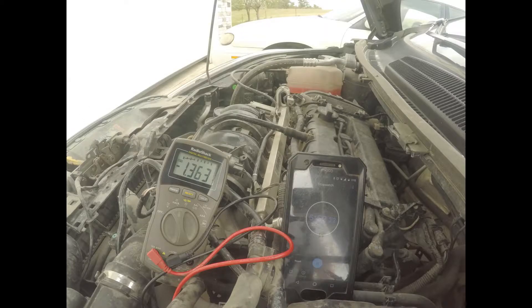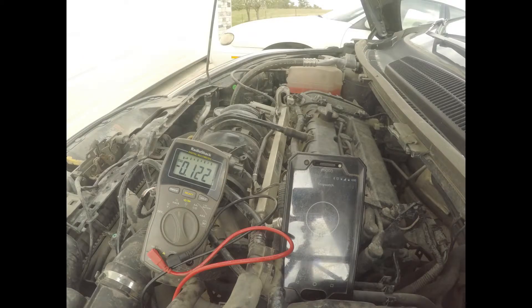Let everything just shut down and go to sleep. My radio stays on for 10 minutes, so you'll see it hang out at 1.3 amps until the radio shuts off, and at that point it's going to drop down to about 0.12 amps. Sorry about the glare on the cell phone — I was trying to run a stopwatch timer so you could see how long it took, but it glared horribly. There we go — we just dropped down to 0.12 amps.